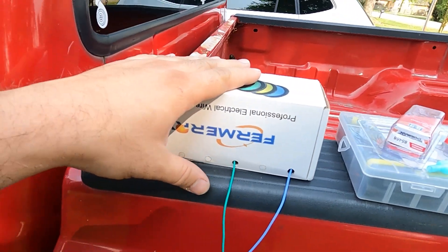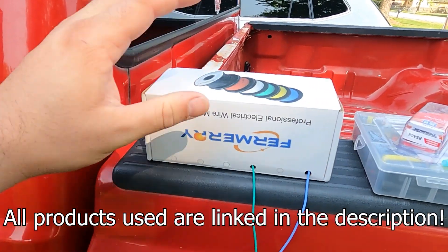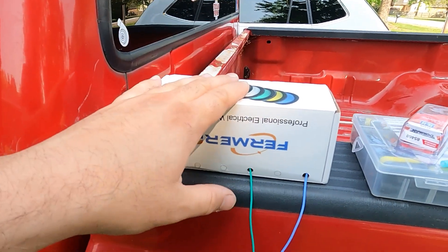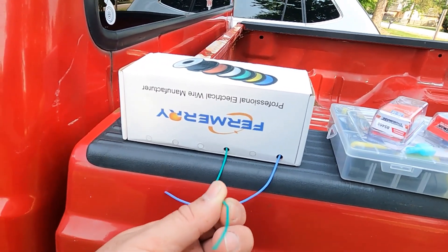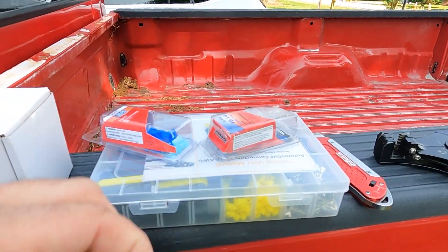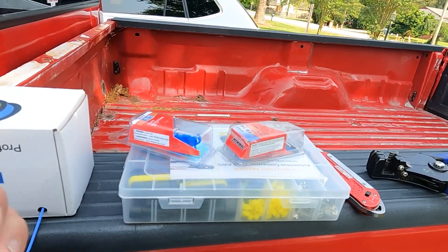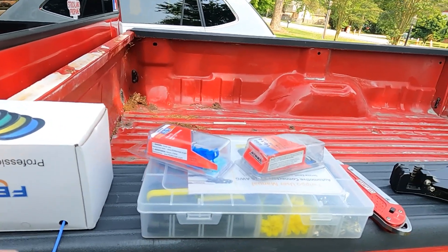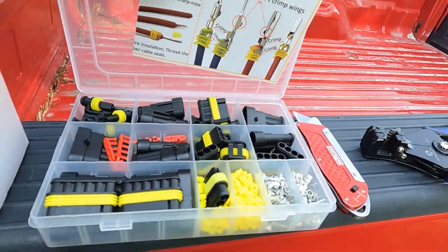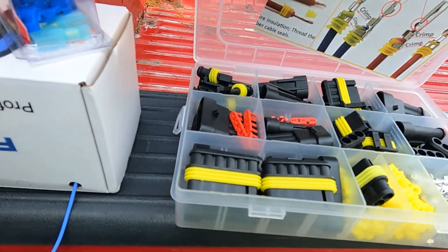It's a new day. Yesterday we got the mirrors on the truck, and today we're tackling the wiring — let's take a look at the tools. We've got some spools of wire — 20-gauge stuff. You might go a little bigger; if I did it again I'd probably use 16-gauge, as this is a little thin but will get the job done. We've got T-taps to tap into the factory harness — quick and easy with minimal damage to the factory wiring. Also some connectors with pins, a good quality wire stripper, and crimps for the pins and connectors.